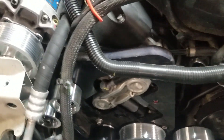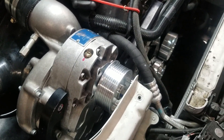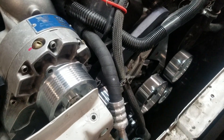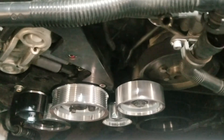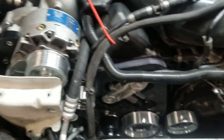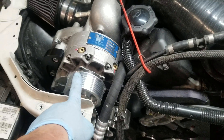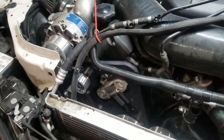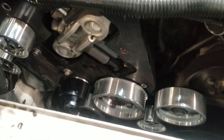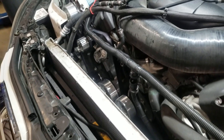Now it runs perfect. We went ahead and upgraded all the pulleys so the customer doesn't keep tearing new belts every several months. We were literally replacing belts non-stop. The reason it tears is it slips, and by the time it starts cutting into the grooves on the belt due to slippage, it tears the belt — causing your AC compressor and power steering to stop functioning. We actually took it to the track and on the very first launch, we broke the belt.